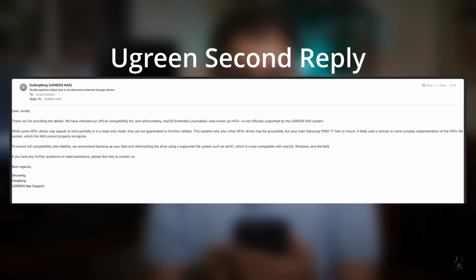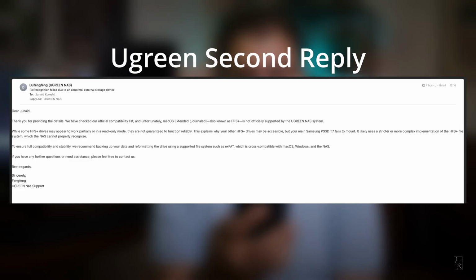Just after that, within 2 minutes, their support sent me an email and it says, thank you for providing the detail. We have checked the official compatibility list, and unfortunately, macOS Extended Journaled, also known as HFS Plus, is not officially supported by Ugreen NAS system. While some HFS Plus drives may appear to work partially or in a read-only mode, they are not guaranteed to function reliably. This explains why your other HFS Plus drive may be accessible, but your main Samsung PSSD T7 failed to mount. It likely uses a stricter or more complex implementation of the HFS Plus file system, which the NAS cannot properly recognize. To ensure full compatibility and stability, we recommend backing up your data and reformatting the drive using a supported file system such as exFAT, which is cross-compatible with macOS, Windows, and NAS. If you have further questions and assistance, please feel free to contact us.